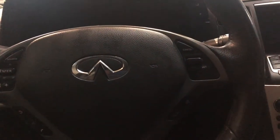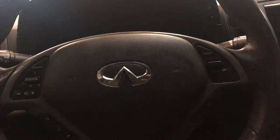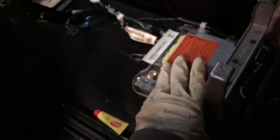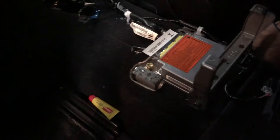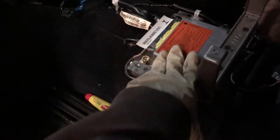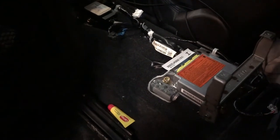The reason for that is just so you can make sure it works if you ever crash again. But it's up to you — if you just don't want to see that ripped airbag sitting right there and you don't want to spend so much money, you could do that. You could probably take your car to Infiniti or whatever brand your car is and have them scan it, reset it, and it might work — they'll probably charge you something. What I do is sometimes I just take these out and send them to a guy and have them reset it. It only charges me like 30 to 40 bucks. You could also buy a new one which is like 80 bucks on eBay. Either way, doesn't really matter.